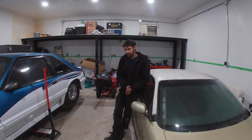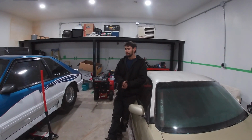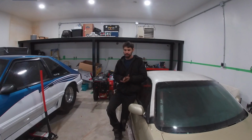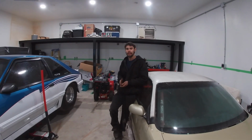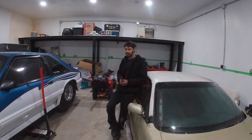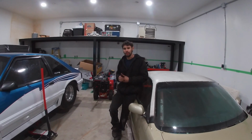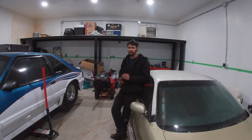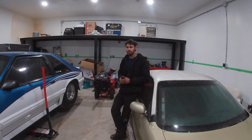So we're changing things up. Same motor, same tranny. What are we doing this winter? Well, a lot. As y'all remember, when we blew up the motor, we put a brand new nitrous cam in it with more duration and more lift than we had previously, and it sounded quite healthy. In the long run, it ended up working naturally aspirated as well. It gave us more top end power. We were seeing like 149 mile an hour normally. We're now seeing 150s, so it's a little better.